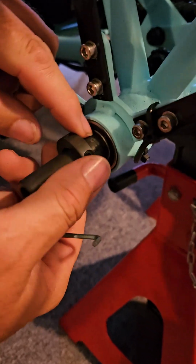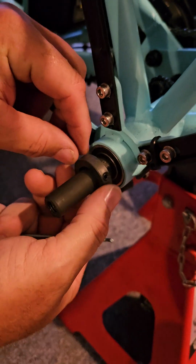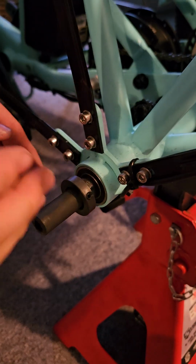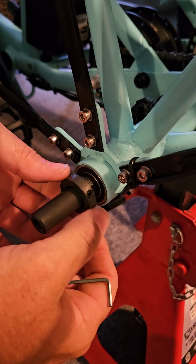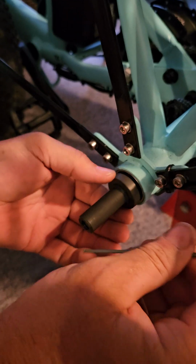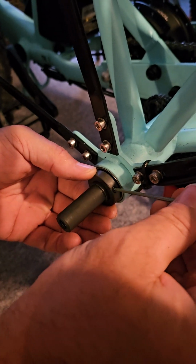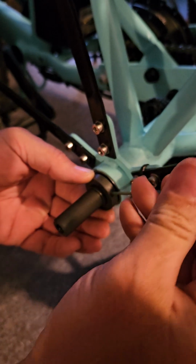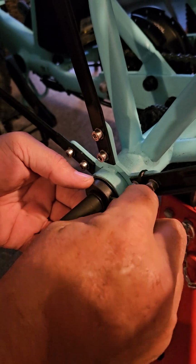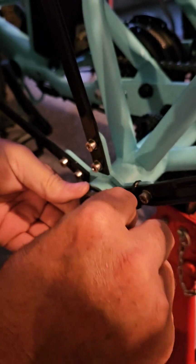You can see that tightening, they do make grooves. Because this was loose, it kept popping over those grooves, and that's what was making the noise. It did sound like this was coming from the right tire, even though this is the left tire that was the problem. We took the right tire apart, could not find anything wrong with it. The popping continued. It sounded like it was coming from the right, but it wasn't until we took the left off that we found that part was loose. Once we tightened this one little part, the popping stopped totally and has not been back. And it's rolled smoother.